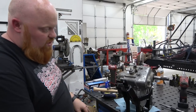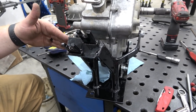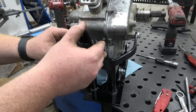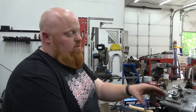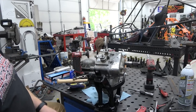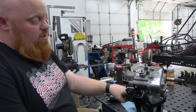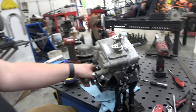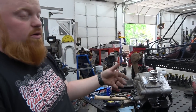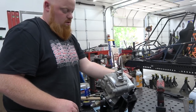Last time we drove it we didn't have this plate up here — I added this plate which significantly strengthened it, so now it's fully boxed and we shouldn't get any flex. There's a lot of stress on this point because these shifters are actually very hard to shift. This is ready to put on the buggy, fully serviced and lubed up. We do need to put a breather nipple beside the fill — we'll run that down to the ground and put a check valve on it so air can only go out and not in, and that'll keep water from getting into our diff if we get in mud.